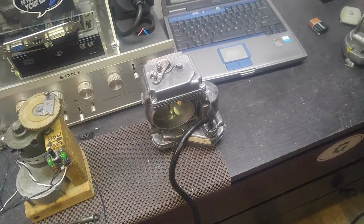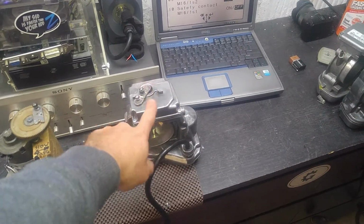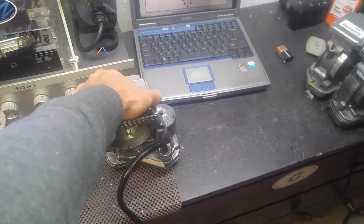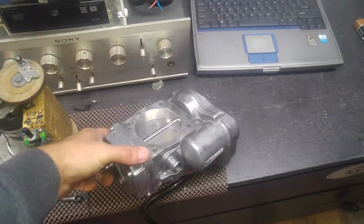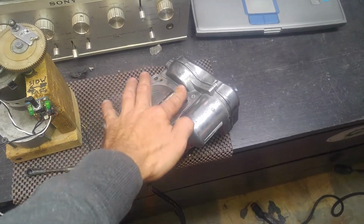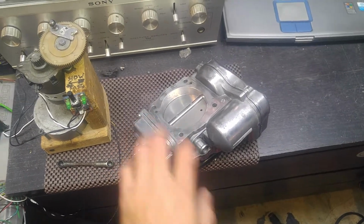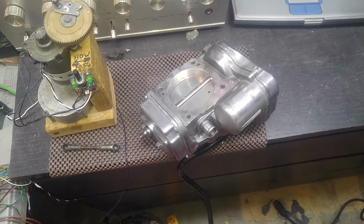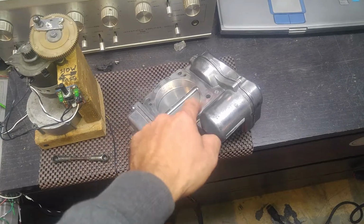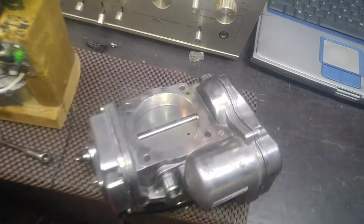So as we spoke on the phone yesterday extensively, you know what you need to go and check with your vehicle. But obviously you want to receive the throttle back, so I am going to mail it out today. Now I cleaned off silicone from the bottom of the throttle, so you do want to put in a new gasket. If you do decide to glue the gasket to the throttle body, you do this on the throttle body, because you do not want to put silicone on your intake manifold, because it will be very difficult to grind silicone off the intake manifold.